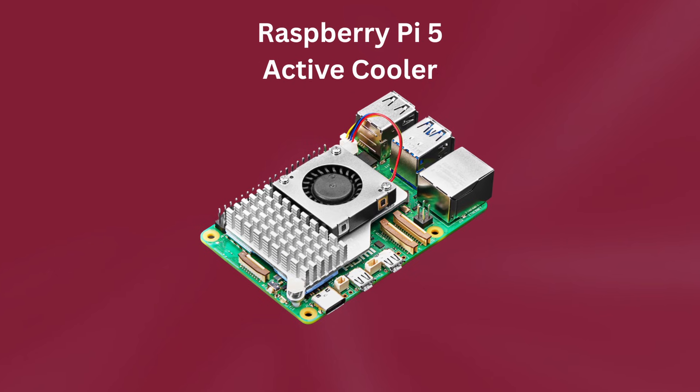So that was the Radxa SATA Hat for the Raspberry Pi 5. In the future I'd also like to add some active cooling, because as of now there's only a tiny passive cooler on the CPU. I tested the temps and they never go above 65 degrees, which isn't bad, but you don't want to stress the components unnecessarily. Is this Raspberry Pi 5 NAS something you would consider? I think the price-to-performance ratio really isn't that bad, and you also get a cool project to learn from. Let me know in the comments — thank you for watching, and I'll see you next week!